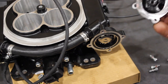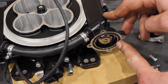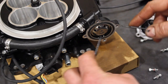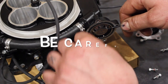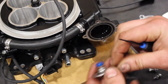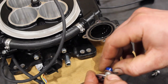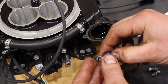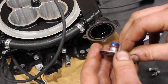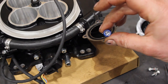Go ahead and remove that piece. Just make sure you keep that all clean because there is an o-ring in here where it's going to seal. There's a little diaphragm in here — it can be a little bit of a pain to remove, but trust me it just pops out because of the o-ring. Sometimes they pop out easier than others. Right here is the issue — there's a little screen on here. This is the actual diaphragm that controls the fuel pressure, a spring-loaded diaphragm. Be sure not to poke anything in there — you don't want to rupture it.